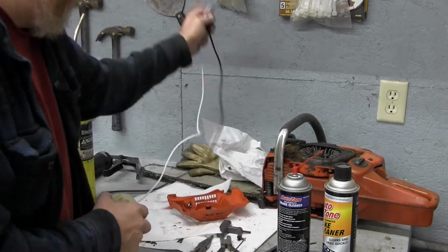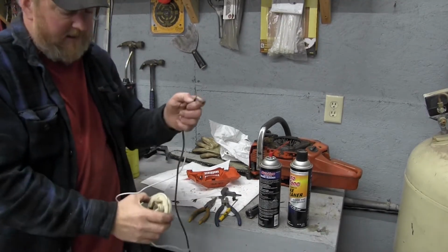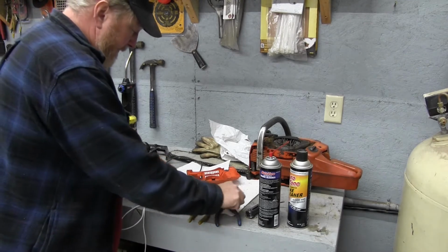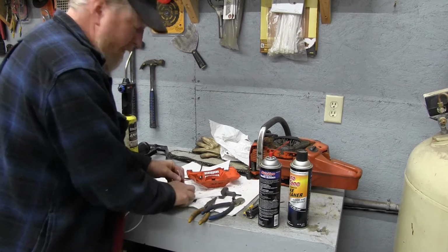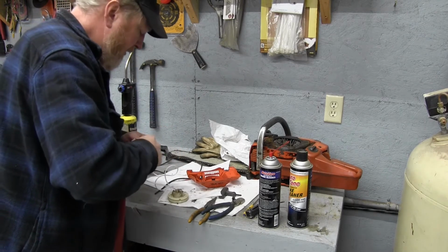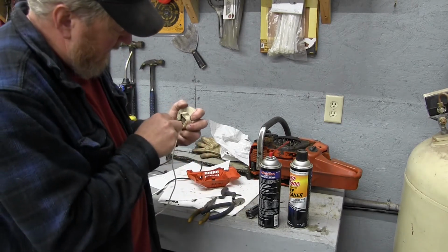We're going to take our old pull cord right here. Let me zoom you out a little bit so you can see what I'm doing a little better. Alright, we're going to take our old pull cord and gauge a distance here. We're going to leave ourselves a little extra because we can cut it off outside. And we're going to cut that right about there. I'm going to pull that back in and tie the smallest of knots, because as you saw, that other cable was actually getting in the way of the washer. I think that might have been most of the problem. Now we're going to pull that knot and use a screwdriver to get it down inside there like so.